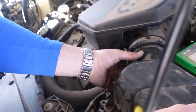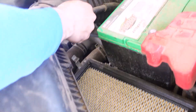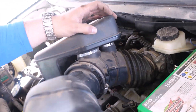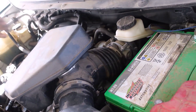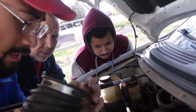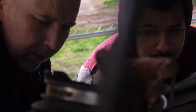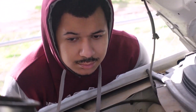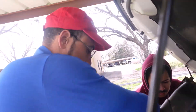The air flow sensor is off. Here's the air box right here — you're gonna take this piece off on the side. I need a screwdriver. Look — you have oil leaking into your throttle body, that's not supposed to happen. Yeah, so you have oil in your throttle body. Put that off to the side.